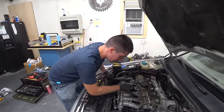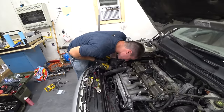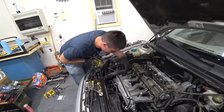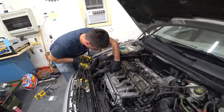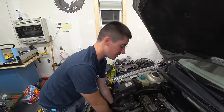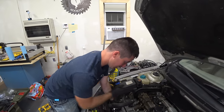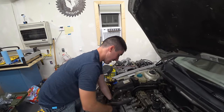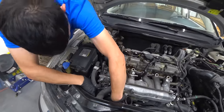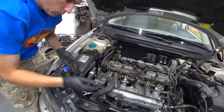Now for the test. I got the bottom two loosened up. There must be one more hiding in the corner — there's a bolt down here. Getting on it is probably the hardest thing you may ever do. You're going to need your swivel to bind up a little bit. You'll definitely have to give up on your impact for this last bolt. We had to get two extensions and the swivel and the 10 and go straight in underneath the power steering pump and the coolant hoses.